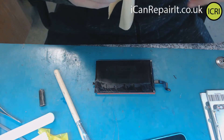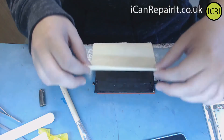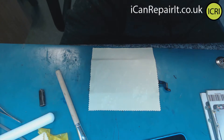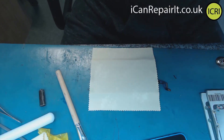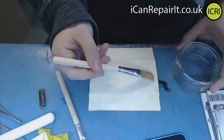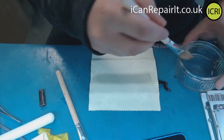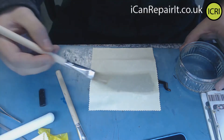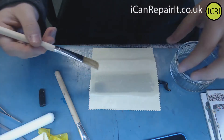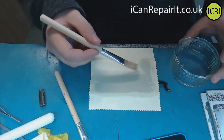Following his advice, you literally put a cloth over the LCD to soak up any excess, then put a little bit of liquid in a small container and apply it down the middle and then to the sides. This cloth is there to prevent the liquid getting into the backlight — something else I've learned from Michael's channel, and I have to give him the credit for that.